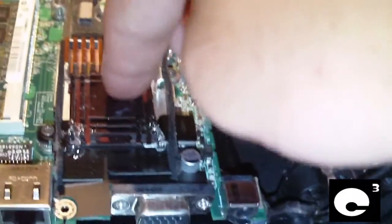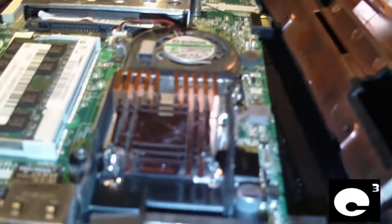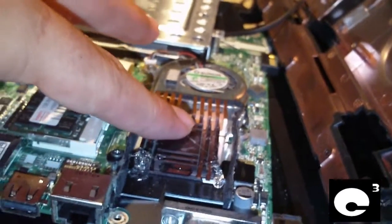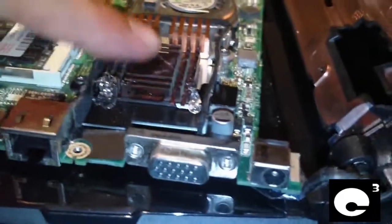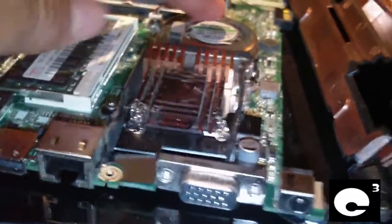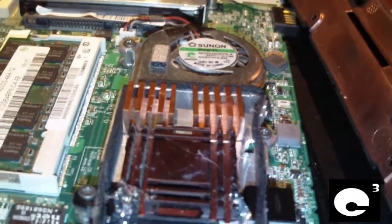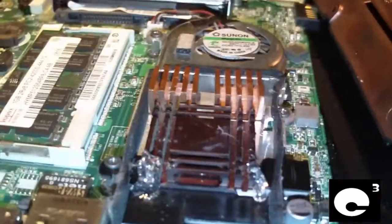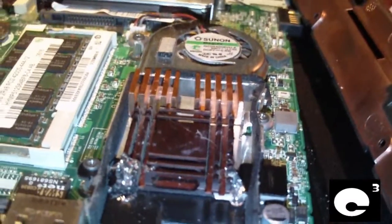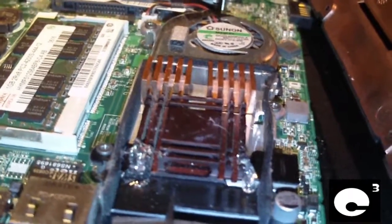The CPU is located right in this area, and the chipset die is right in this area. This heat sink also covers what looks to be a choke. These Aspire 1 netbooks, for cooling, all they have is a cooling plate — a very, very thin piece of aluminum that covers the CPU and Northbridge. There's a very slow-running but annoying-sounding fan, and I've seen software out there that turns down the fan speed, which feels great to quiet down the netbook, but it's not good for the computer because it already has a crappy cooling system to start with. Why make it even worse for the components?